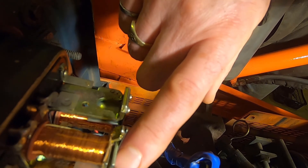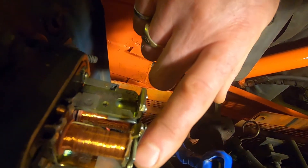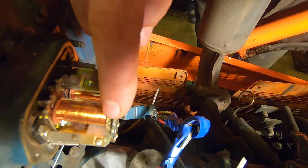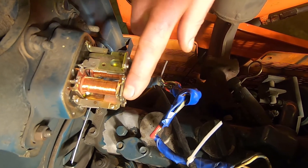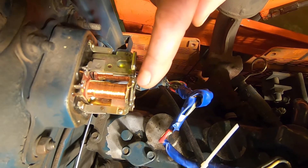As you turn headlights on, hazard lights, and other electrical loads, the duty cycle will increase — in other words, it'll be charging a larger percentage of the time. When people talk about adjusting, they're really adjusting the duty cycle: the amount of time that this relay is engaged versus disengaged.